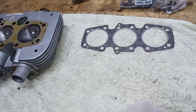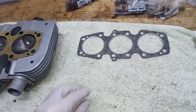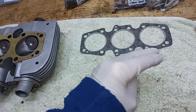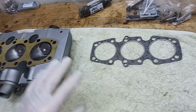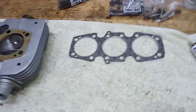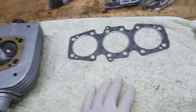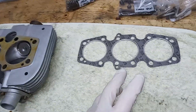The third one I've heard of is the Cometic gasket, which allegedly is the best of all. It's a sandwich — metal, then some sort of goo, then metal at the bottom. When you tighten it up, the goo kind of seeps out and seals everything — allegedly. I say allegedly because I've never used one. But I think if you're having trouble with the head leaking and you can't cure it, then you might go for that.